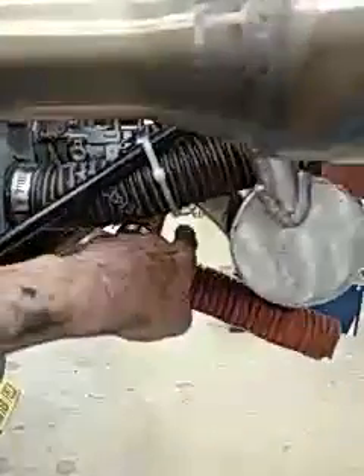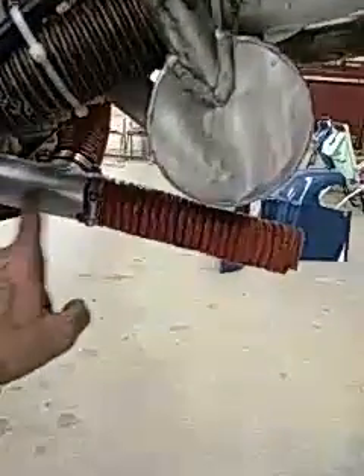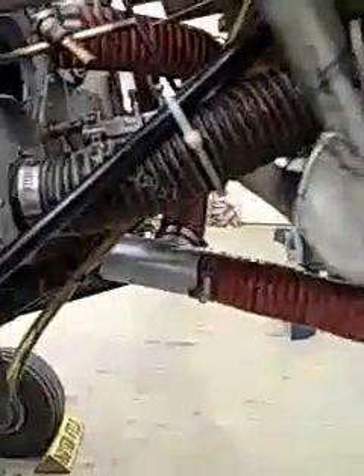The air cleaner — this is the air box. This is the carb heat tube here, and there's really nowhere to get heat from. When I was looking at this, it looks to me like there's room to run — if I run this exhaust down, I can go right in here and do a two-into-one and then come out here. I think there's room to do that on both sides, so I'm going to look into doing that.